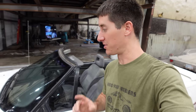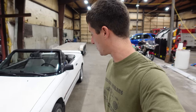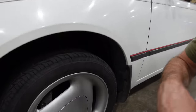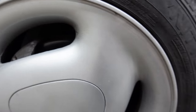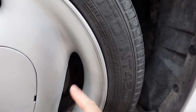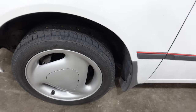Now let's move on to the real problems — the brakes. The brakes are the biggest thing I noticed on the way home. This thing first has like no stopping power, and it is wildly bucking in the pedal while you're trying to slow down. I'm going to guess that some of these rotors are either warped or there's no pads left. There's no screeching noise. But if you look, that rotor is heat checked and it does look pretty rough — there is some grooving for sure.